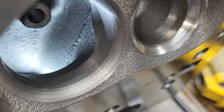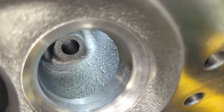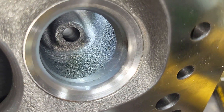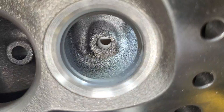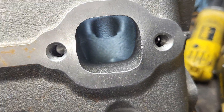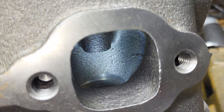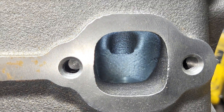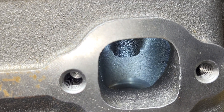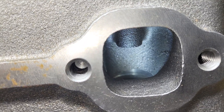Let's measure the height of that short side — intake short side, 1.1 inches. So they didn't change that. This exhaust port will clean up so nicely. I think you'll be surprised what kind of flows we can get out of this with a 1.5 exhaust — they're going to crank. The exhaust port is not a massive giant port like Dart likes to use; they kept it smaller, it's only 1.3 inches tall. It's really a great exhaust port. I think the headers he has are only 1 inch and 5/8ths, so it doesn't pay to make these any bigger — I've got to keep them tight and get the most out of them for their size.